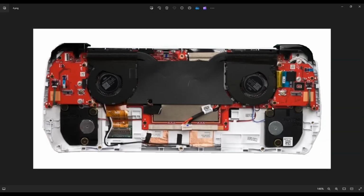Now, the next thing I'm going to take you into here is on either side, one right here on the right, one on the left. This board contains the vibrator, as well as your analog stick. To get each board off, there are four screws on each board near the four corners. And as with a lot of boards that are quality, there'll be this white triangle or arrow near each screw that fastens it down. A lot of motherboards have this, but it's really cool that they've put this on these boards as well, so you can see which screws need to come up.